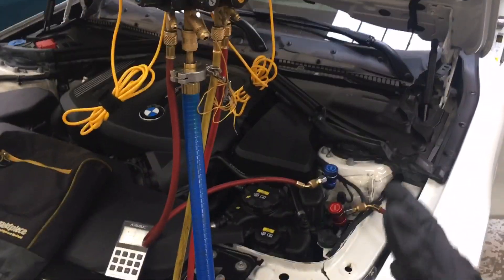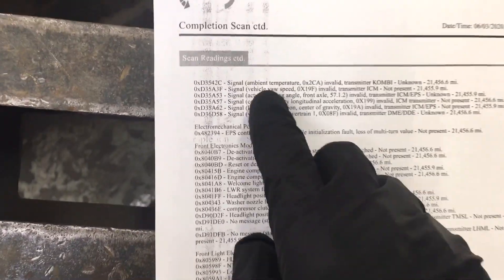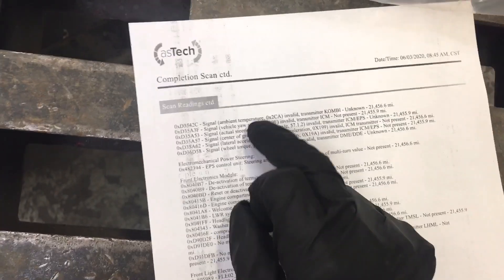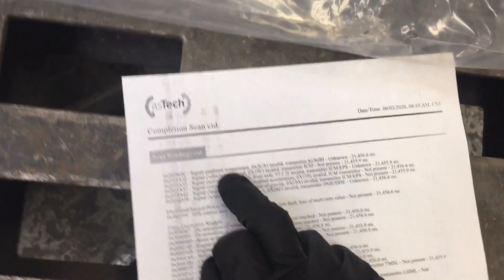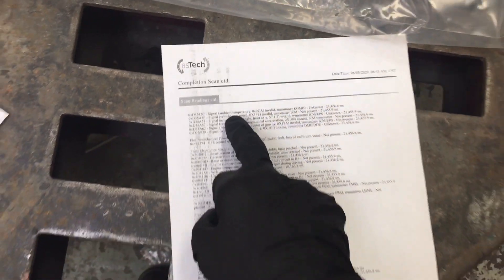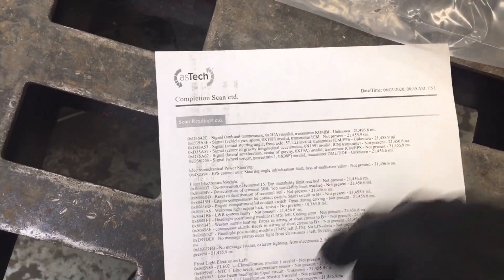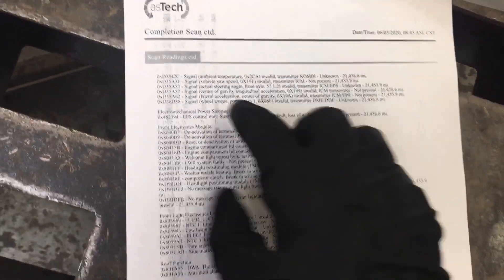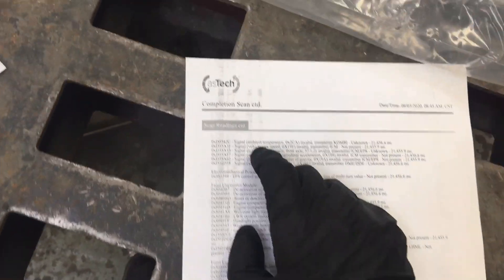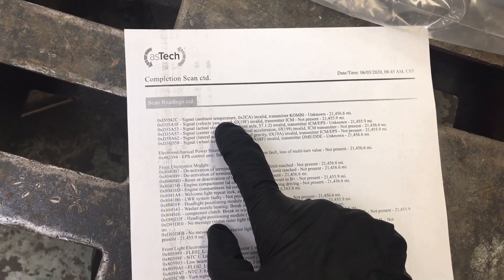It already went on the scanner to one of those companies that catered to body shops for scanning. They showed me the paperwork, and I told them before — they didn't even tell me this was a recovery. I thought I was doing a recovery or recharge or something that they pulled it off. I got the spray of the refrigerant up through my vacuum pump and everything like that because it was full. Then I got the rest of their story after the fact. I asked them about their ambient air temperature sensor — was it in a collision and some wiring harness had to be replaced? And they told me yes.